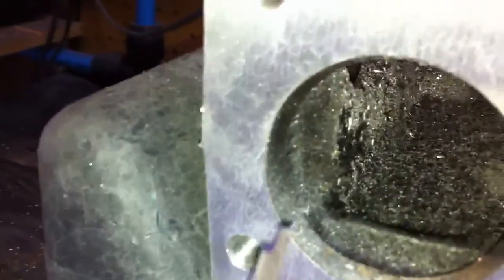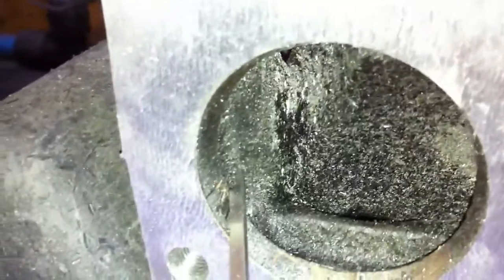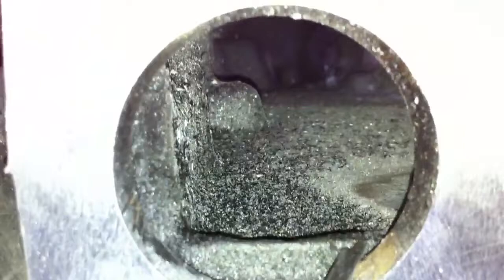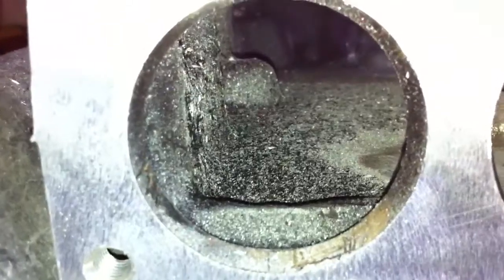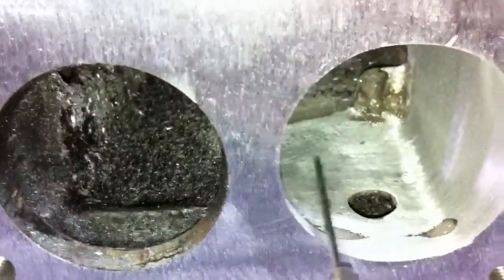You can see in here — there's a little ledge. It's a pretty small area, right in this area. It's kind of square, and it doesn't allow you to get the full benefit of the airflow from the throttle body. So you can get rid of all that — kind of radius it in, smooth it in on the sides, in here, and down in here.